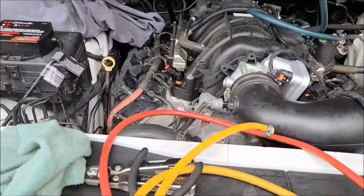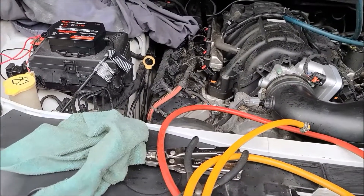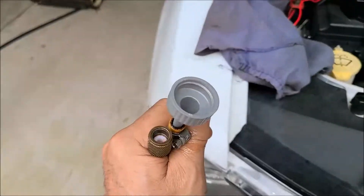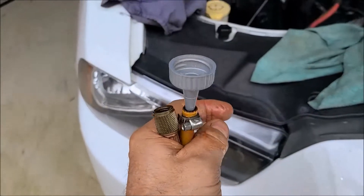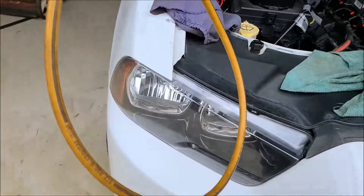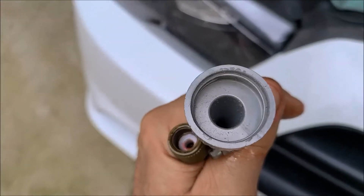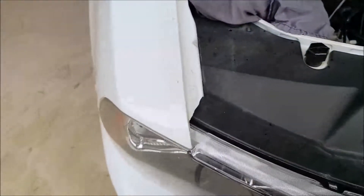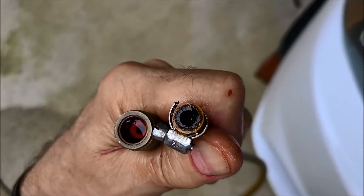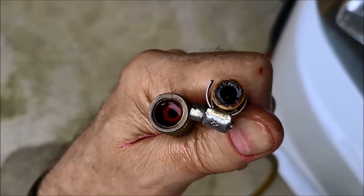You can also use an injection cylinder where you fill it up and push it through, but I'm not going to use the full two ounces — this will take about one ounce. I made a little funnel out of a gear oil squirter top that I had extra. I'm going to fill this hose up until it comes up to the surface on the other side equally, and we will have all the air out of it. After some juggling, she's full. I got all the air bubbles out by making one end lower than the other and back and forth until all the air is purged without losing too much fluid.